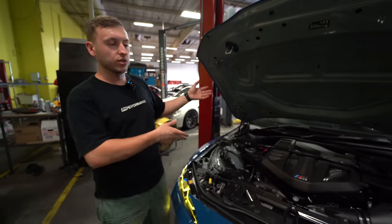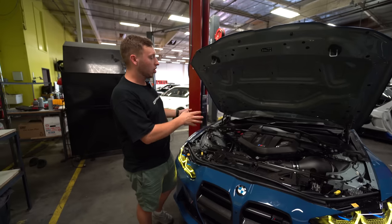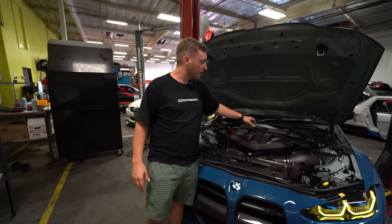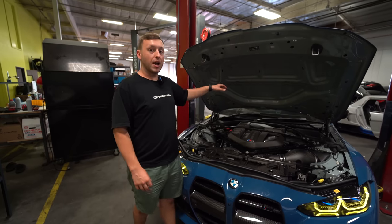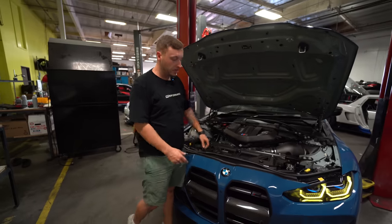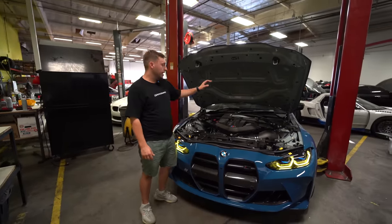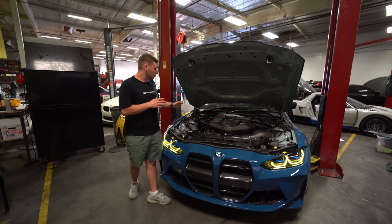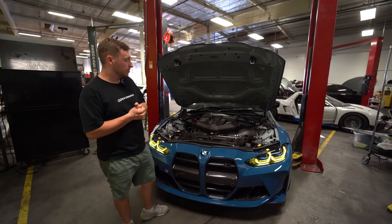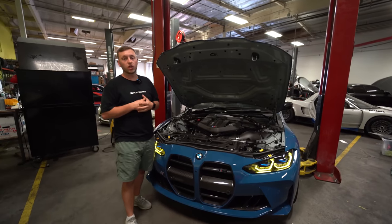If you've seen episodes 1, 2, 3, 4, and maybe this is 5 or 6, you'll see the car's had a lot. It's currently running a Stage 2 Plus package. So it's got a CSF inlet manifold, PI, it's got Mike Bull harness all the way around. It's got the full CSF cooling package, so that takes into account the front heat exchanger, transmission cooler, inlet manifold, fully billet. It's just got stock turbos, R44 200 cell sports cats, and R44 titanium system. So it runs at healthy power. If anybody's seen some of our footage over in New York, it's a quick car.